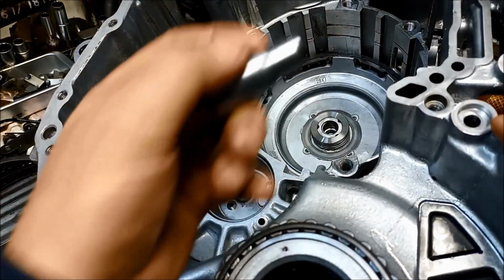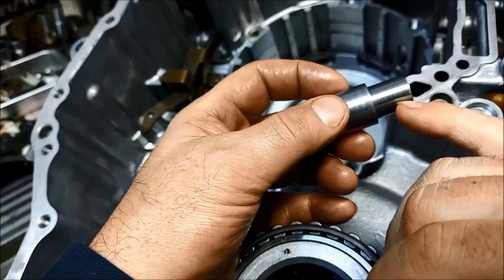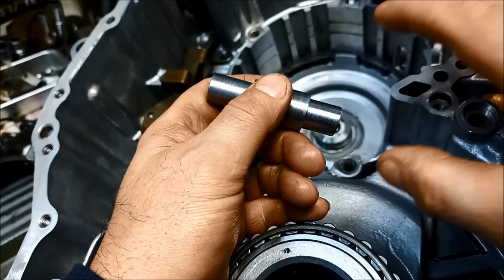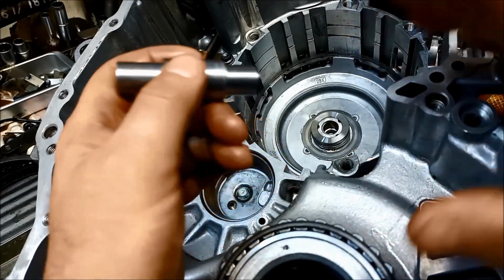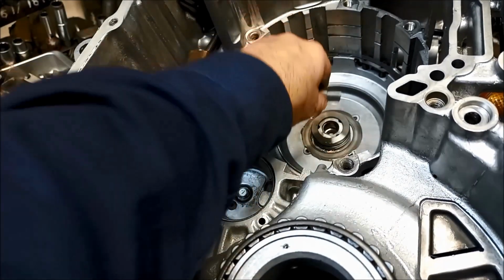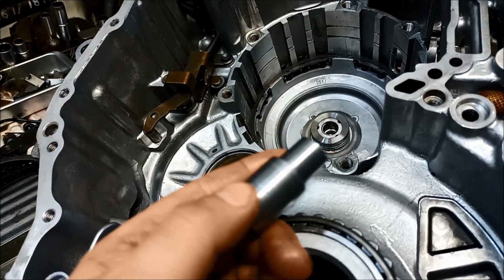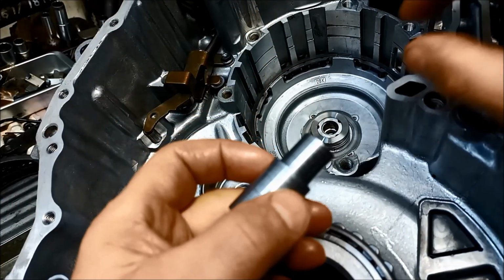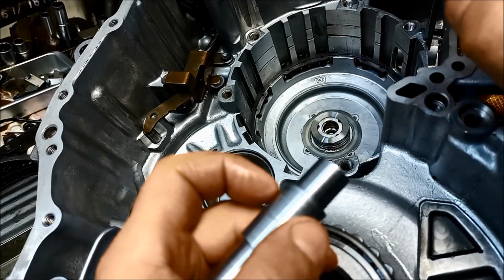So what that actually tells me, that at that diameter bushing, there is less than 3/1000ths of an inch play in that bushing, which is actually what you need, because to allow for heat stresses, things expanding and contracting with heat. So 3/1000 is alright. So that bush doesn't really need to be changed. If the wider part was loose in there, flopping around, then that would tell me that that bush needs to be replaced. And this one is okay.